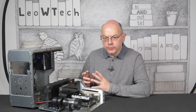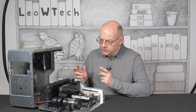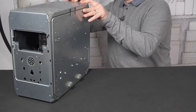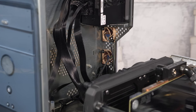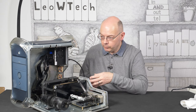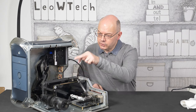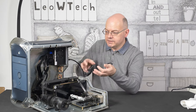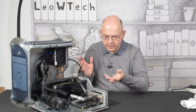To recap: I've gutted the original Apple system from this G4, converted it to mini-ITX, installed all the big bits and pieces required to make it a mini-ITX PC, and all that hardware is on the door. Before I installed the cooling loop I installed a couple of Noctua 140mm fans at the rear of the case — hopefully they will help the cooling. I've also tidied the cables in the bottom of the case. I haven't yet connected the power to the graphics card, motherboard, and EPS at the top of the board — the idea is that as I close the case I'm going to plug those cables in, rather than use extensions.